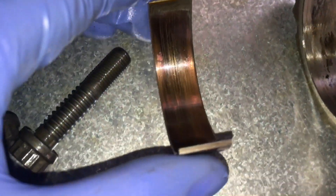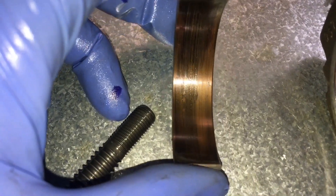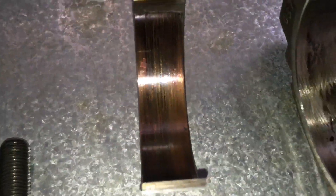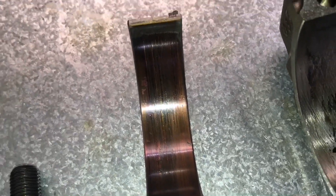When you look at these bearings you see not only the visual wear but the layers — on this end here there are different layers, probably about five visual layers. Not only have we got copper but we've got coloration like blues, greens, and yellows, and there are also lots of debris and small impact marks. There's even a little dent over here — that's just where particles of the bearing have probably been breaking up and going around, just keep on impacting as they're letting go from that location.